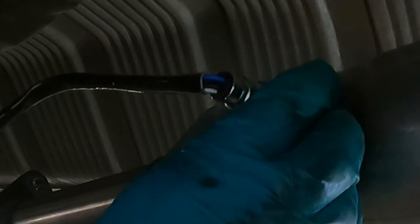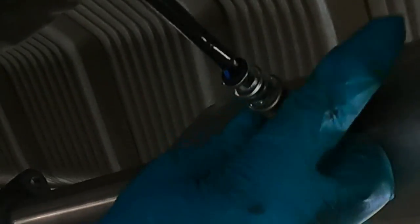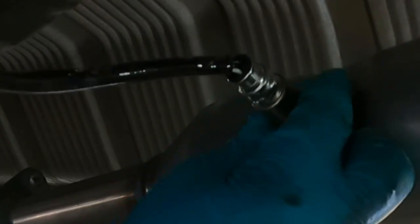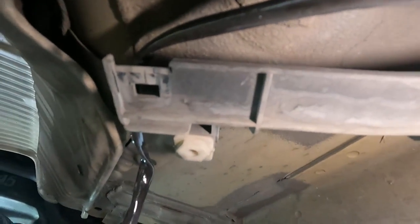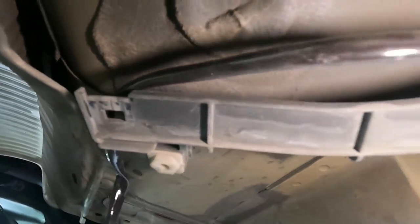Here's the downstream sensor that I got — a Denso 234-4797. Amazon said it was the right one and it looks like it is. I'm going to thread this in first so we don't tangle the cord up. I'll grab a couple of zip ties — there are probably some original plastic clips there, but it looks like this clip here holds this part up. Right now I'm just going to get the old one out.